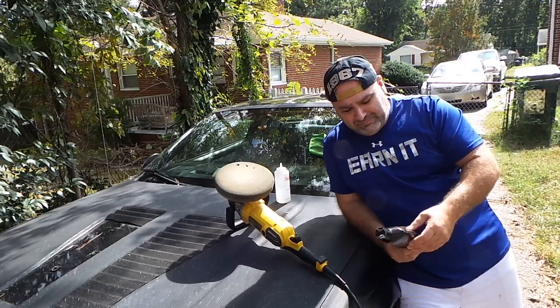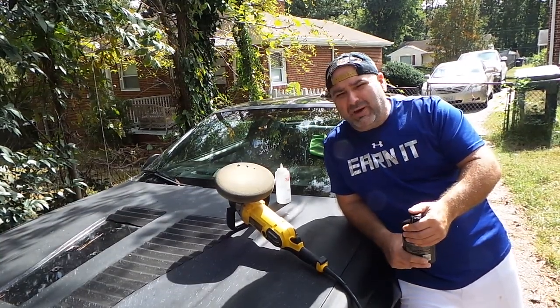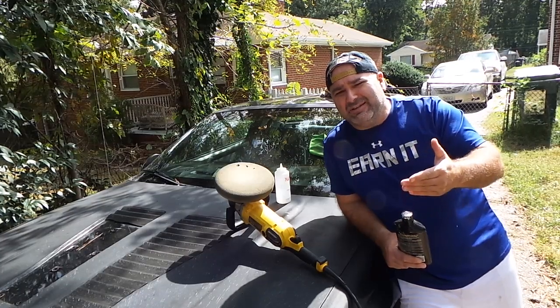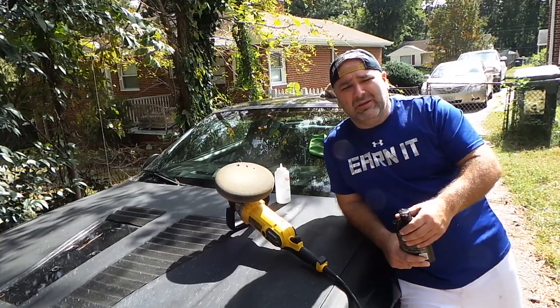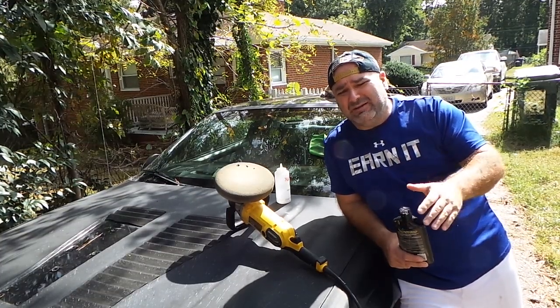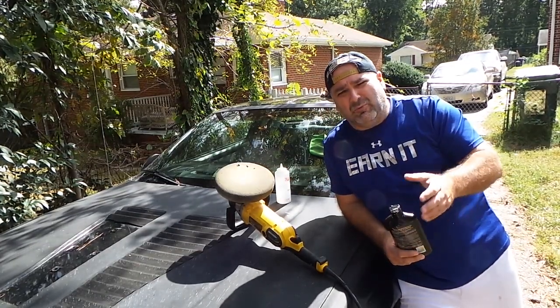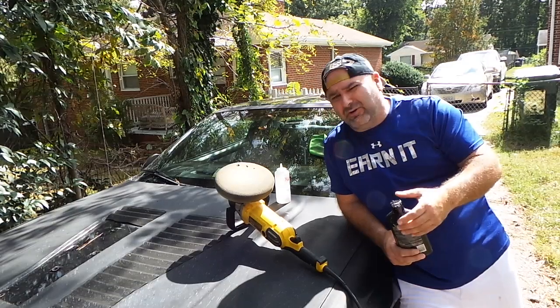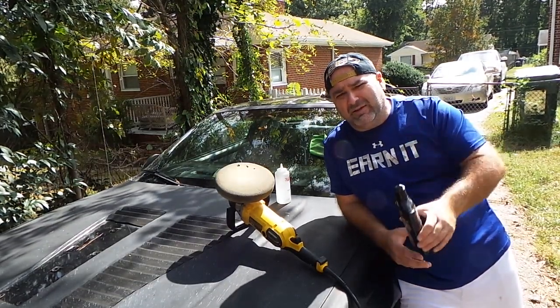How do you resolve this? How do you make it go better? We'll get you some polish or some compound. I'm going to start with polish because I'm scared — this car is a 1986 model and this paint is old — so I am not wanting to take any more off than humanly necessary. So I went with a light pad and I'm going to go with a real slow rating, like about 600 RPM, and I'm going to use Meguiar's polish.